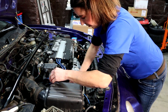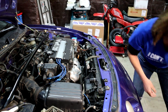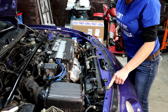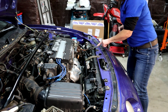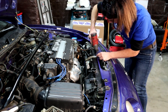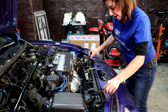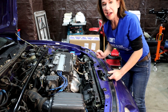Let's go ahead and pull out this hose completely. Now we're going to take off these three brackets — well, remove the three 10-millimeter bolts. We're going for this one, this one, and this one, making sure we're in reverse. One, two, and three. Now we can move on. These two brackets on either side lift right off. The one in the middle does not come off, so we're just going to push it aside.